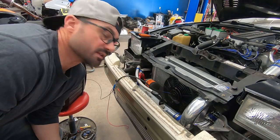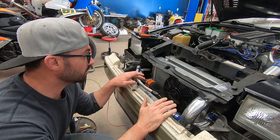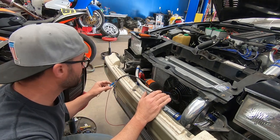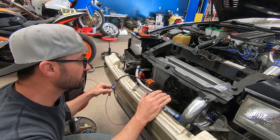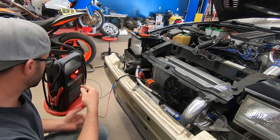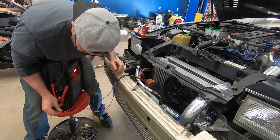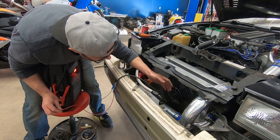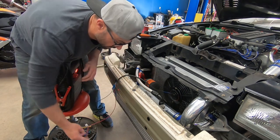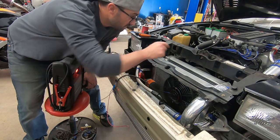Before wiring this in, I need to make sure it's wired for the proper polarity since it can be wired in push or pull. I'm assuming the blue wire is positive and the black wire is ground. On the connector I have the ground wire connected to the blue wire and the power wire connected to the black wire to reverse the polarity. Using my battery pack and some temp connectors to test it. Watching the blade — it felt like it's pushing. I was correct. It's wired up correctly — it will be pushing and the other fan will be pulling.